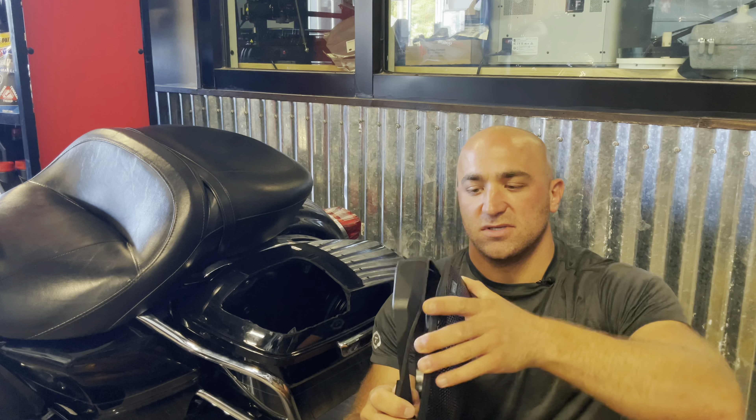So now we're going to go ahead and load our 6x9 in here, which we'd already had done. I didn't like how small these screws were and they were starting to cause dimples in the Hertz mounting. So what I did is I got a really small washer and I'm just going to add it to these screws to give the screw a little bit more surface area to bite on.